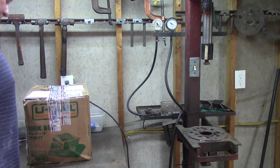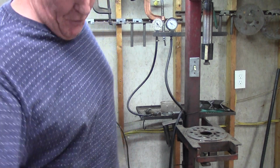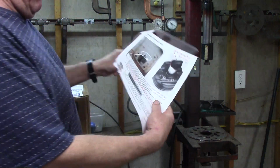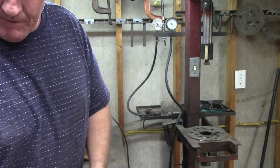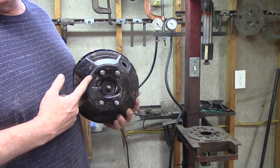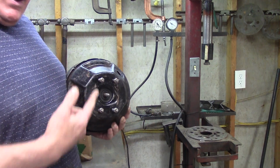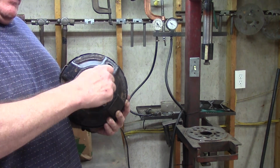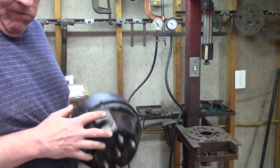It is the biggest success of all time. But you have to be careful, and we tell people in the directions. Number 1, master cylinder studs are only supposed to be 100 inch-pounds or less. That only works out to about 12 foot-pounds. We get people that use impacts and ratchets and twist these off.